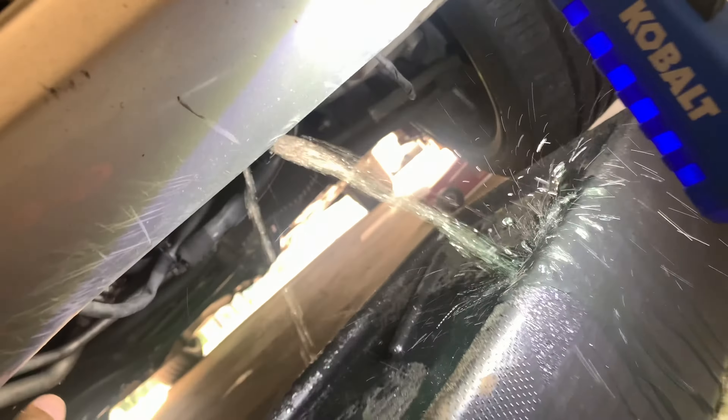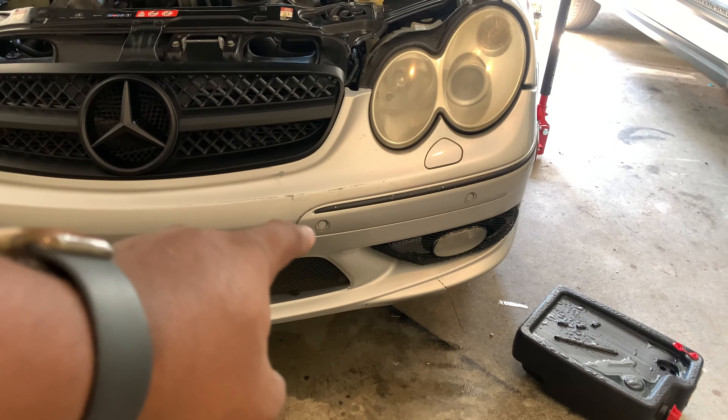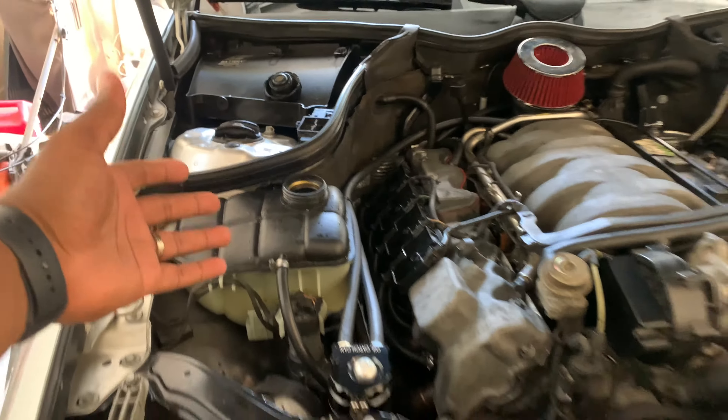I've got help opening it from the top. It's not going to be perfect — you're going to get some spillage anyway, but when you're done just make sure you clean it up. Everything got drained out and I went ahead and closed the cover on the radiator. The next step is to fill it all the way up with distilled water and turn the car on until it gets to 80 degrees Celsius — that's when the thermostat is going to open up and circulate through the heater core, water pump, and thermostat. Leave the cap open until it starts rising; it's going to burp itself, and if it runs down just add more distilled water. We're going to repeat the same process until we get clear water.